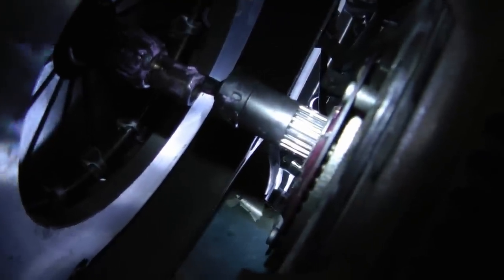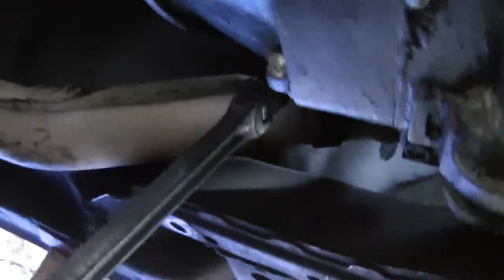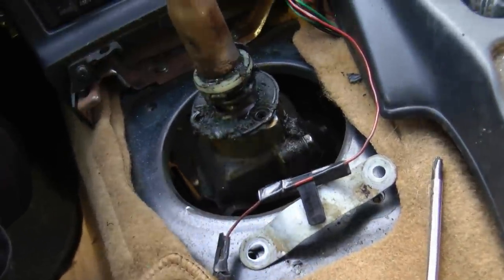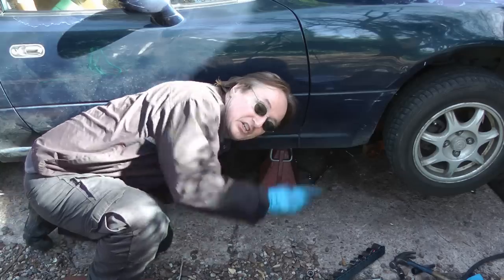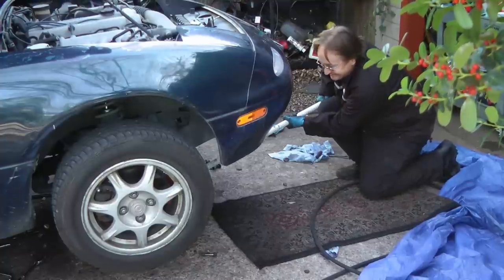Then you slide the clutch alignment tool with the clutch disc in place so it's held in place correctly by the tool, then the clutch plate fits right on top and bolts back on. Then you slide the transmission in — it might take a lot of wiggling — then put some big bolts on to hold it in place while you jack the rest up. Then slide the drive shaft back in the transmission, bolt the drive shaft to the rear end, put the gear shift lever back in and bolt it in place, screw the gear shift knob back on, jack it up and get rid of the jack stands, let the car down, and take it for a spin.